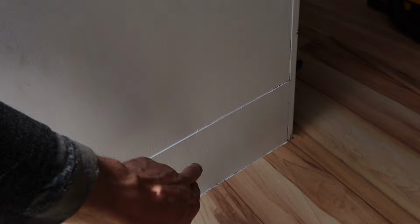And then, in addition to that, I just finished repairing this section of rot here. So that is all, this is anti-mold mildew paint. I've got it on both sides of the wood, then I've got the edges sealed with Sikaflex on the bottom. So yeah, it should be good. I just gotta put some trim there and then do another coat of paint. So things are coming together really quick now that it's sunny outside and I wanna work fast.